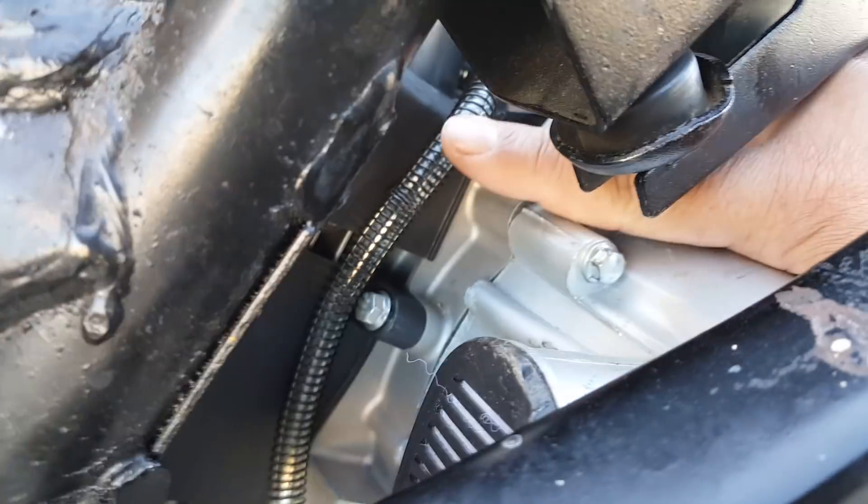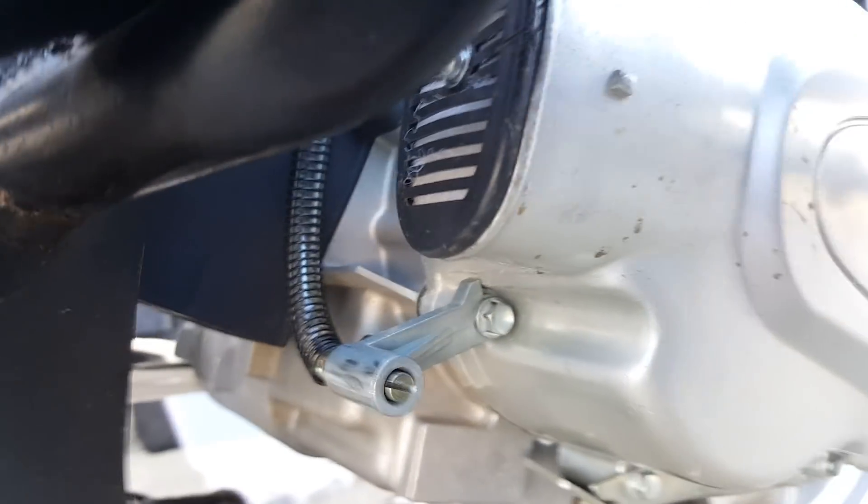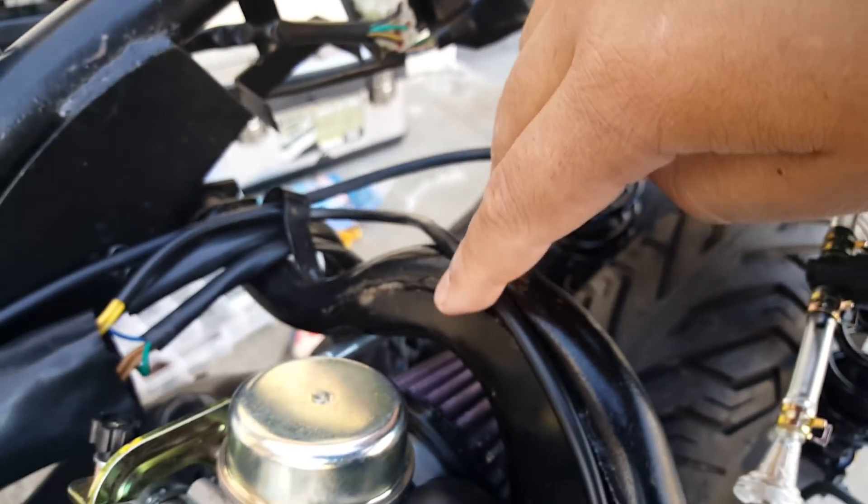I put it clear also, but I put little protector springs here — I just took them from the old one. That way it prevents the heat from burning the hose. You want to keep the hose as far as possible away from the engine heat, since the crankcase usually gets really hot.